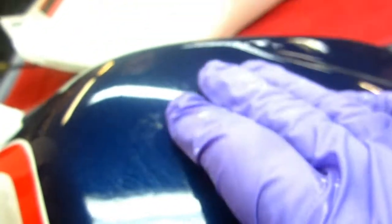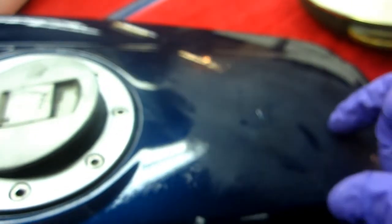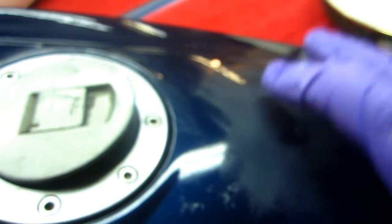We basically, from this point on, there's not much we can do. This is going to have to be resanded. The whole blue has to be resanded. So I guess there's no point even trying here. We're not going to make any big deal. I'm going to have to sand that down. I'm going to have to, in no particular sequence, take the gas cap off, sand all the blue, reprime this. The primer is to try to seal the part underneath it so that the blue doesn't go down in and eat this up. The primer is not there for any other reason than just to seal it. So the next step on this is going to be a very time-consuming thing, probably more than an hour or so. I've got to sand all the blue till it looks like that.